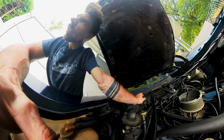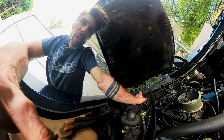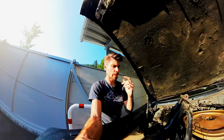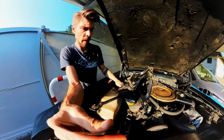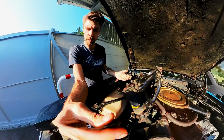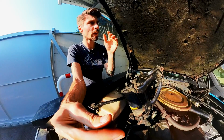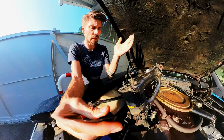Maybe it has something to do with my AC compressor. I think I wanna rewire that and see if that changes the thing. I didn't really think that that would solve the problem, but I tested it anyways. I plugged the AC compressor back in to every connection there is, just to see if that eventually caused my charge light not to come on the dashboard. Yeah, didn't help. Now I know that, and I can leave this compressor out, so the charge light still doesn't come on. And I still have this parasitic drain of 0.3 amps, which I can't resolve.